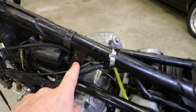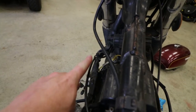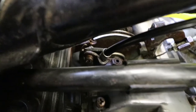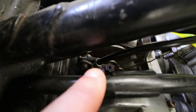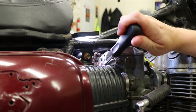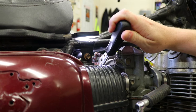I'm going to move around to the other side of the bike to show you where this choke cable routes to. The choke cable goes way down inside here, and you can just kind of see there's a clasp or a little bracket. This is a lovely easily-stripped Phillips head screw — or a JIS screw, which it most likely was from the factory in Japan. So we're going to go ahead and loosen this screw to undo this clamp. A way easier way you could have done this is to take the airbox off, but I'm not taking this off because I know I can get the anchor off the other end of the choke cable off of the lever that it's attached to down here.